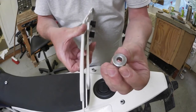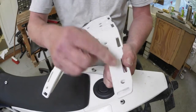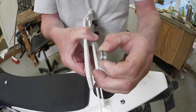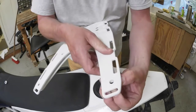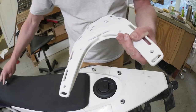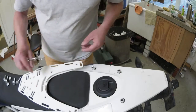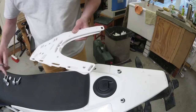Next, you have to put the four spacers in between the parts of the rack for these four holes. However, out of the box you have to force it apart a little bit, slide it in there, and voila — position it. You can install the rack after you do the second one also. Now that these two spacers are squeezed in there they won't just fall out. Don't put the other ones in yet because those are loose.